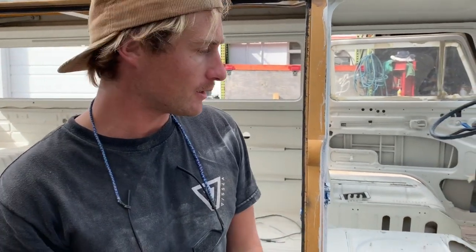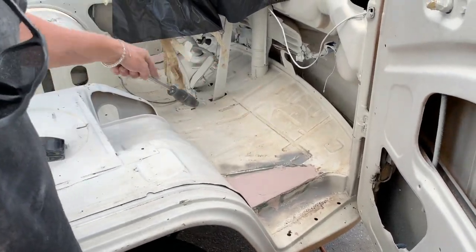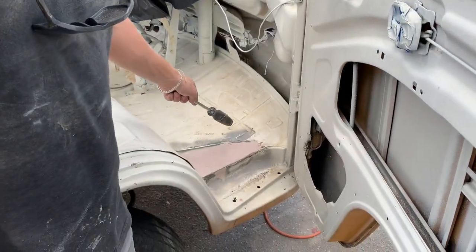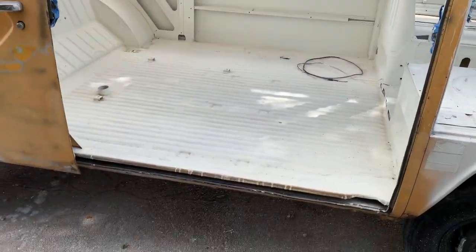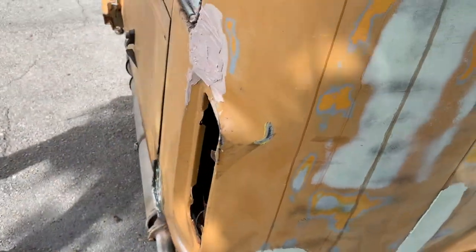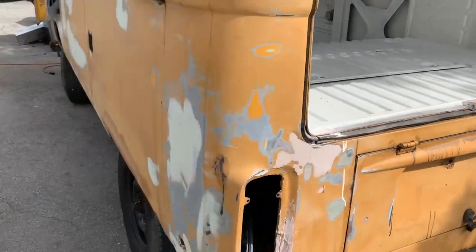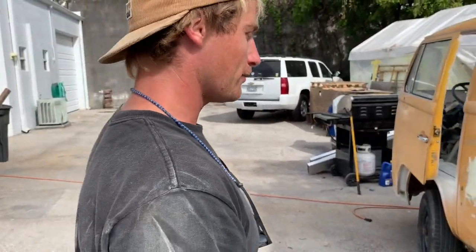The interior will then be done. What I've done is sanded all the places — everywhere you see little gray spots, I've welded in new plates and filled it up with body filler just to even up all the welding spots. As we go along you'll see pretty much everywhere we've filled body filler for all the dents and dings. I'm going to fair everything, sand it, and make sure everything is nice and smooth before we put primer on and get it all painted up for the new color, which we'll still reveal.